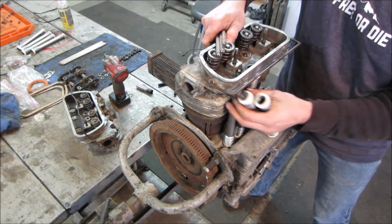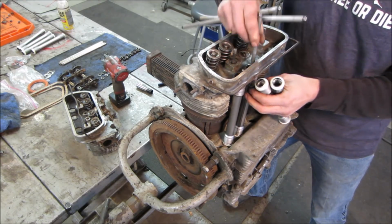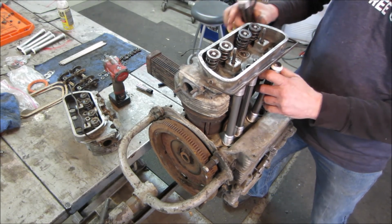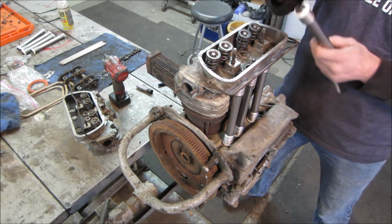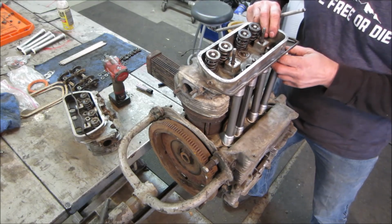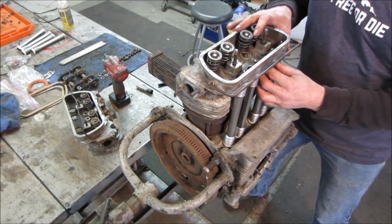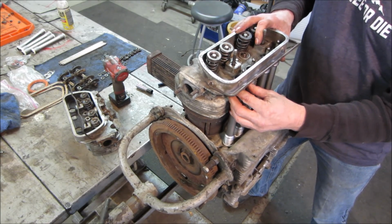What I mean by that is there's a spring loaded, you can see it on the sides of it. So when you're trying to crank down on the cylinder head, they will fight you a little bit, especially if you're using new ones. So you kind of take your torque wrench, and actually even before the torque wrench, you kind of just draw all the hardware down.